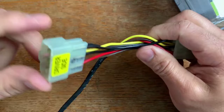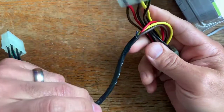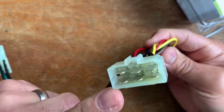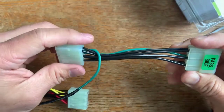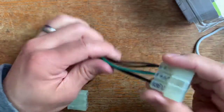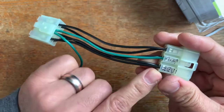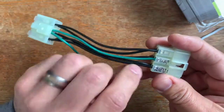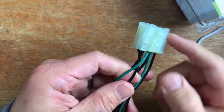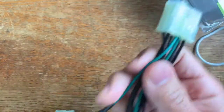On the driver's harness for the trailer harness, it picks up the brake light, the turn signal for the left side, and the running lights on that side. For the passenger side, all it's really picking up is the right turn signal. Turn signal again is top center. And then I labeled this as my reverse, as it's going to be for another project — I'm actually going to run an additional wire off of this and through the harness just to match this side so that I can run brighter reverse lights when I back up.